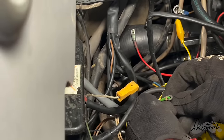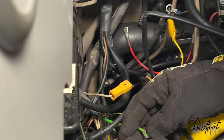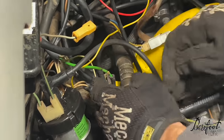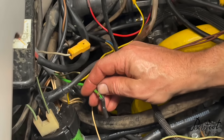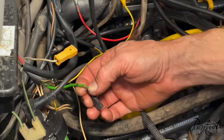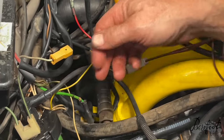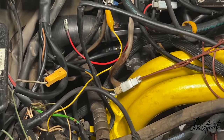Is that... It's broken, but I don't see... You see the inside... Yeah. See, you know how these wires are? Yeah, there's a second shielding wire on the outside. And if it touches the center, then it makes them run very rich. Can you cut it back further? You can just cut it, and then they won't be touching, and you can fix it later. It should run perfectly fine with that cut.